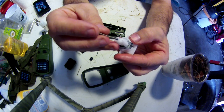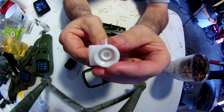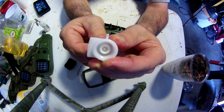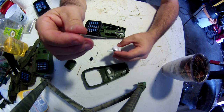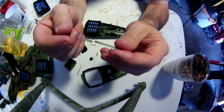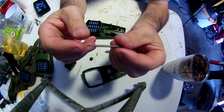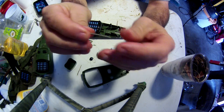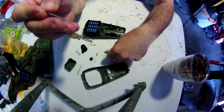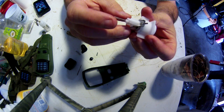What that spring does — it actually goes in here and pushes on a pin that goes into the butane cartridge, allowing the butane out. What I found was it wasn't engaging the butane cartridge entirely, so it wasn't letting enough butane in to stay lit or ignite. Simple fix: I pulled on it and stretched it out a bit, and now it puts more pressure on that pin and fully engages the butane cartridge.